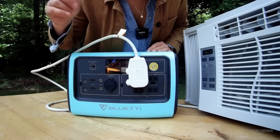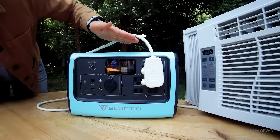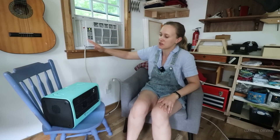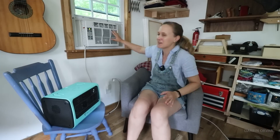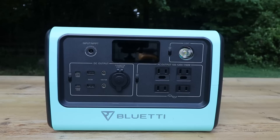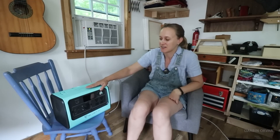How about the AC? I tried power and energy mode, getting 58–64 watts. On cool it's only drawing 51 watts. However, I was using the air conditioner and couldn't get the compressor to start — which is kind of weird. When I plug it in the wall, the compressor comes on. The reason it's not working here is because there is no ground. The top AC plugs look like they have ground, but they must just be empty holes. So if you need a ground for your unit to work, it's not going to work here.